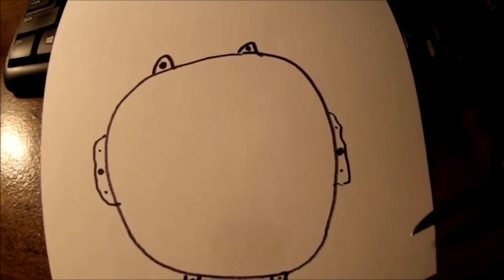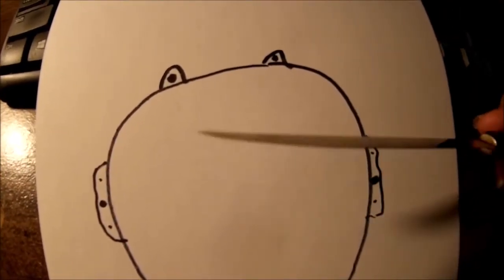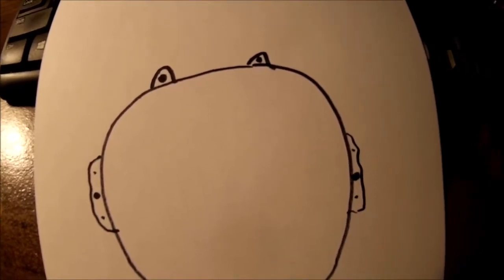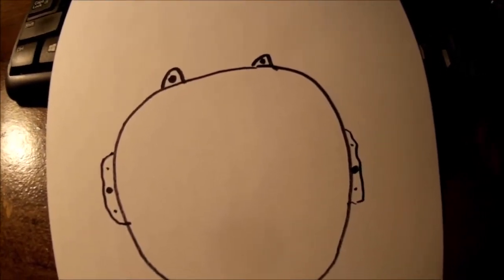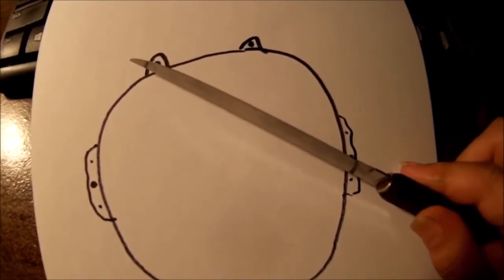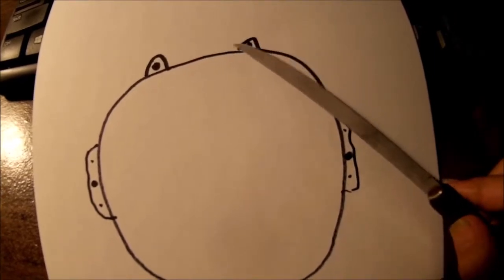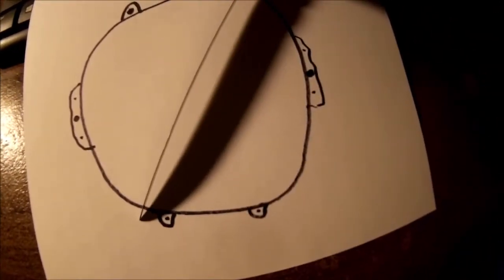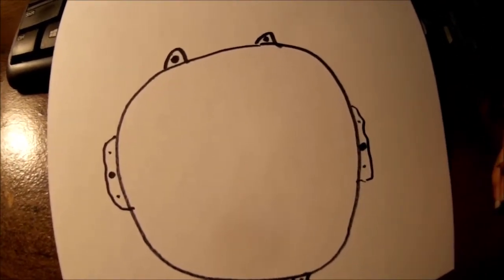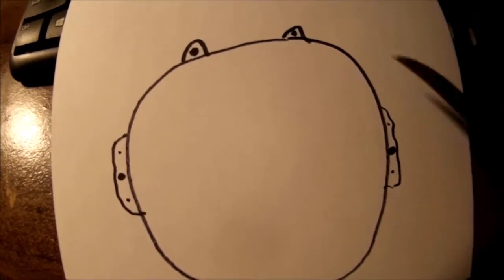Now, why is that? What I didn't consider, figuring I'd just hang it off of these two, is that it didn't eliminate this axis. It eliminated a lot of this axis, which helped some. I got it close, and it would get an inch away and it would stop. By taking this out of here and putting it over here, this is on a diagonal now. So it actually changes that axis. Instead of being hung here and being able to pivot this way and a little bit that way, it changes those axes, which keeps it more lined up and easier to get in there. That's why it only took 20 minutes once I moved that locator pin.